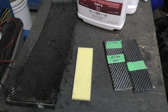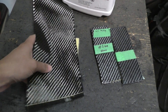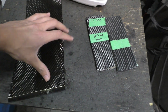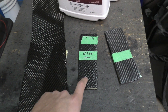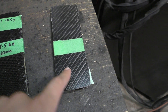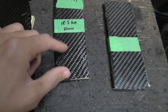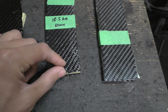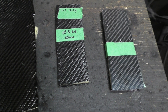For making my parts, I'm starting off with the foam core, putting the carbon fiber on it, and then covering it with resin. The final thing I'll end up with will look something like this - it's not going to look as good as vacuum bagged pieces which give you a really nice surface on top. My surface is just going to have all exposed weaves, but I'm not concerned about looks - just the functionality of the part.